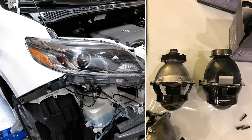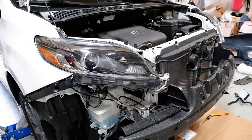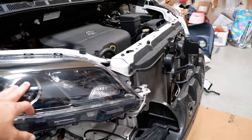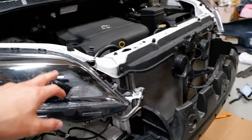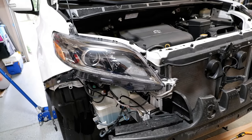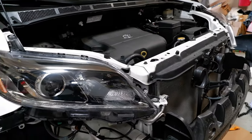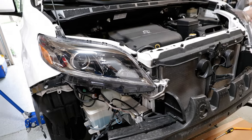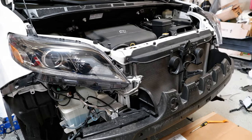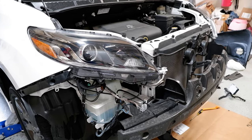It's pretty much a drop-in projector for this car. You've got to do a couple of little mods and I'll show you those — they're pretty simple, with a drill you can take care of it. I had to drill a little slit for the bi-xenon, because these actually have a high beam and a low beam. So your high beam is going to be awesome on this because you'll have the halogen high beam and then the HID high beam also, which the factory HIDs and halogens don't have. That's a really cool part of this retrofit. The projectors are pretty cheap — they're like $110 or $120 — and you get them from TRS, Lightworks, and any of the authorized retailers. I'll have a link to them in the description.